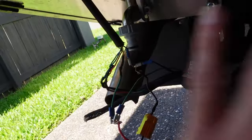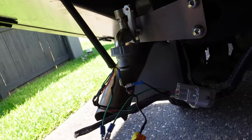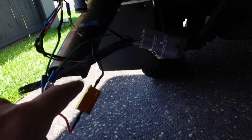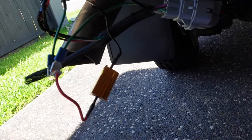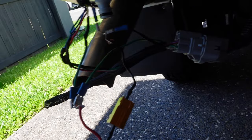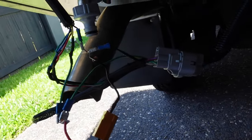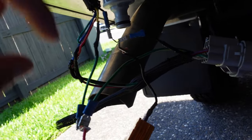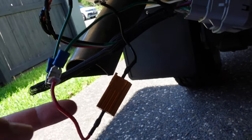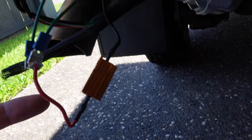Now in this circuit, what we've got is that tricked load. I just touched it and it's hot — that's because it's soaking up a lot of heat. It's very important that we don't put it anywhere near these wires. It's going to be fitted onto the underside of this aluminium here, which acts as a heat sink. So keep that in mind. You're basically creating a circuit with that extra load, tricking it into thinking it still has its halogen or filament bulb in there.